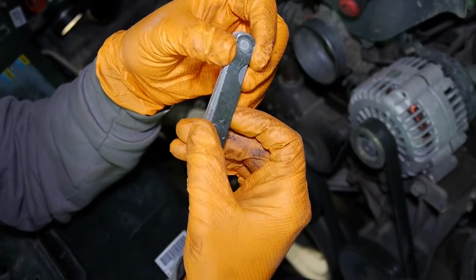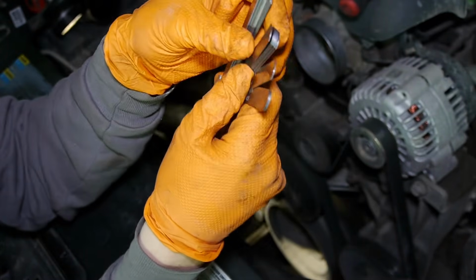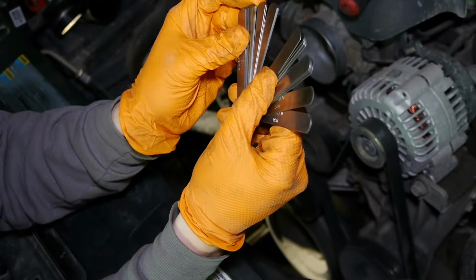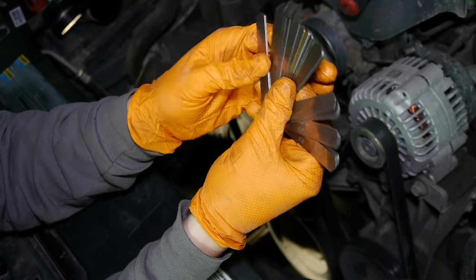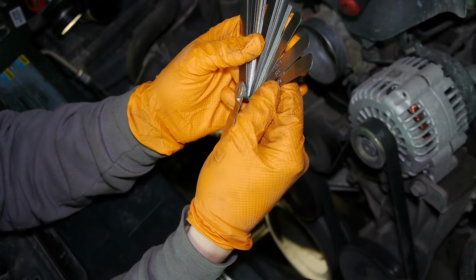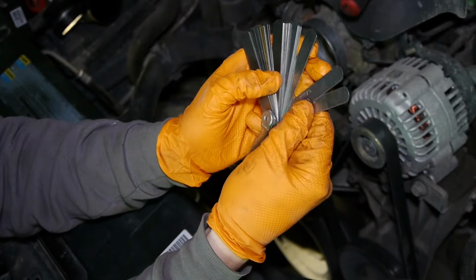To measure the gap, you'll need a feeler gauge. Don't worry, they're not expensive. I'll leave you a link in the description. A feeler gauge has all these little sheets of metal on there at a whole bunch of different thicknesses. So you can push it in gaps and see how thick of a sheet you can push in so you know how big that gap is.